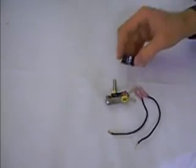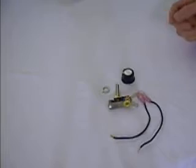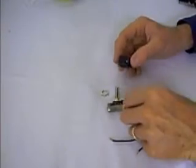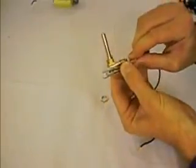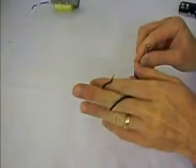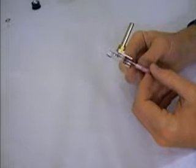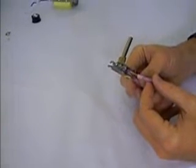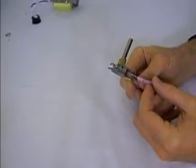There is an option to buy this thermostat with a kit as well. It comes with two wire leads, a control knob, and the nut that holds it into place — which comes with it whether you buy the kit or not. It also comes with a micro screwdriver so you can set the set screw onto the shaft. The leads hook on simply and give you good wires for connecting to your heater and power source. For best performance, it is recommended that the fan be situated so air blows directly onto this thermostat, which speeds up thermal transfer and makes it respond faster to the environment.